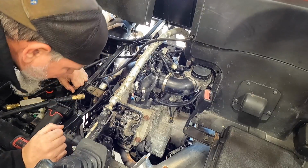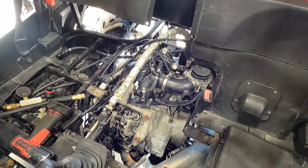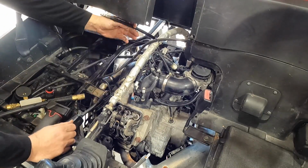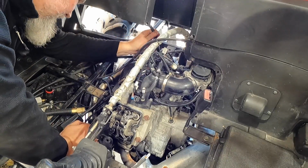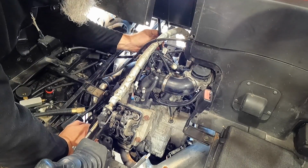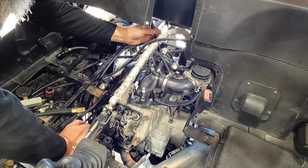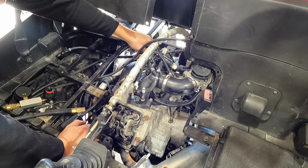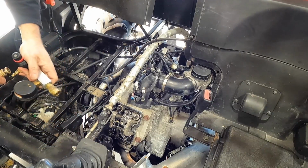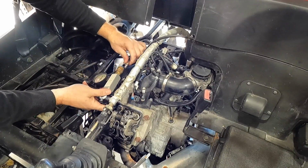I will grab that here shortly. And then let's go ahead and see if we got a blown rear head gasket, which they call the rear on this one is cylinder 1, cylinder 2. So cylinder 2 has a blown head gasket. I'll back down all the pressure again, because it doesn't take much, as you can tell.